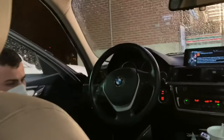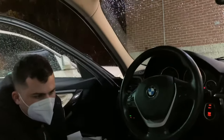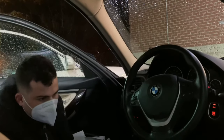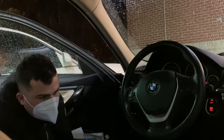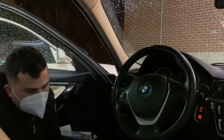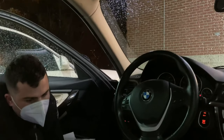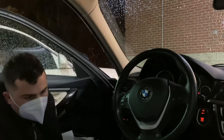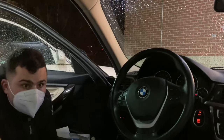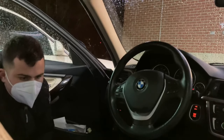What issues do you have with it? So the big thing is the power drains really fast. The car's been pretty reliable, but when you leave it for more than 3-4 hours, you can't start it. So I already replaced the alternator, already replaced the battery, but they said that through the OBDII port, the power is still draining out. That's where they detect power draw.